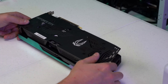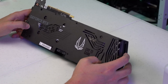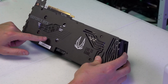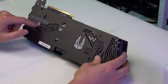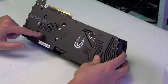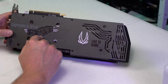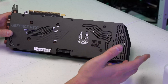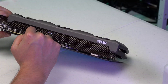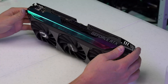I've learned that you can make it picture perfect, or you can do it a little quick like I just did and the results are the same. I tend to like to make the pads a little bit bigger on the back. As you saw during the time-lapse, there aren't actual memory chips on the back like there are on 3090s — however on these you just have a little more room to put thermal pads to dissipate heat back onto the back plate.